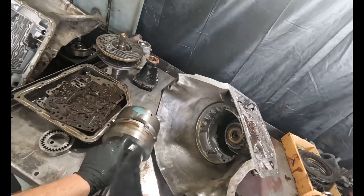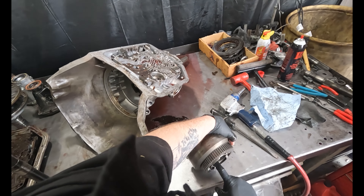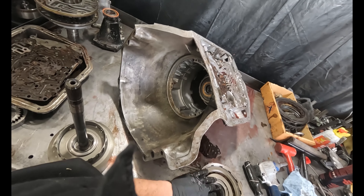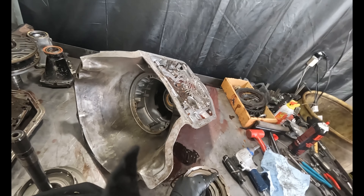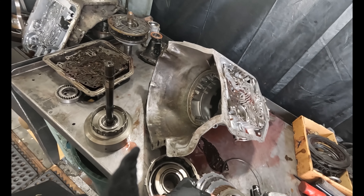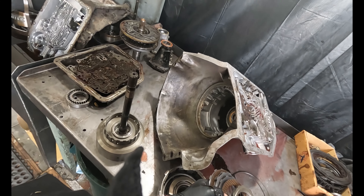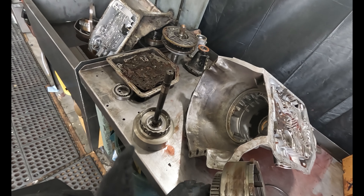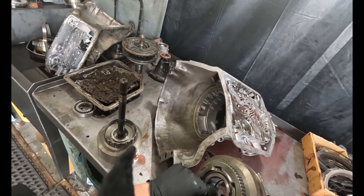Roll it — sprag's tight. The drum is finished. He needed this drum, but this is bad. Plates are hit, but again, it doesn't matter. The drum is screwed up — it's all grooved inside of here from the pump.